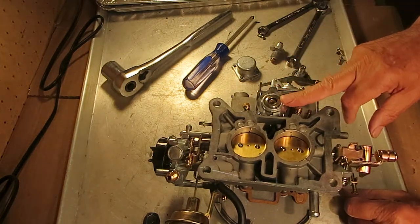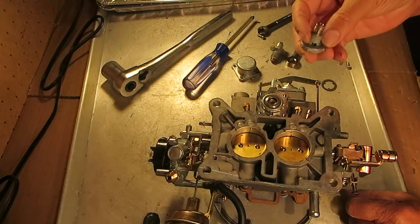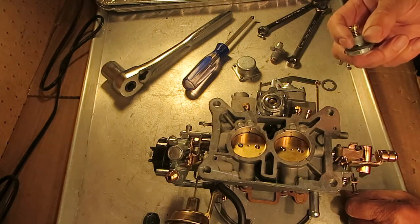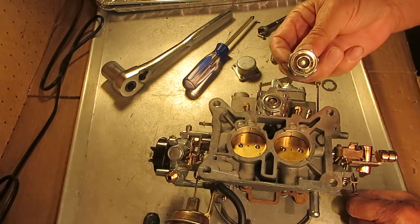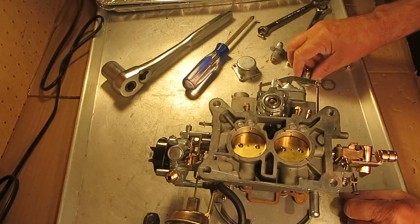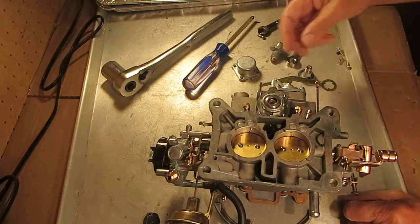This is on the 2150. They work the same on a 2100, except all 2100s are single-stage. All the Holleys are single-stage too, and they work the same way. A lot of times they're the same power valve that a Motorcraft takes, but you won't find two-stage on a Holley, as far as I'm aware.